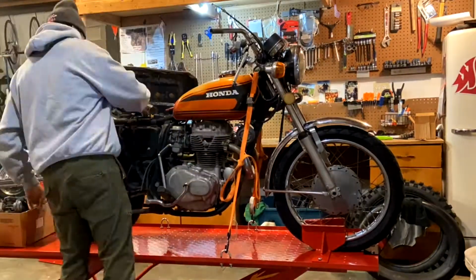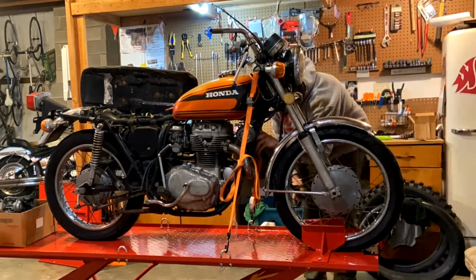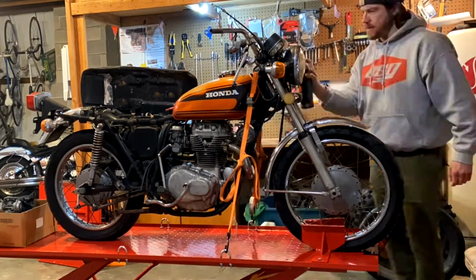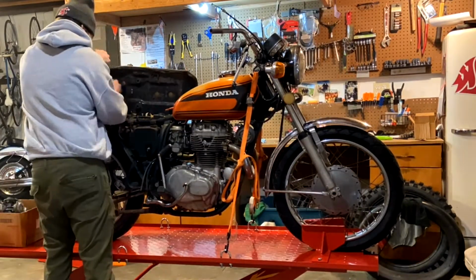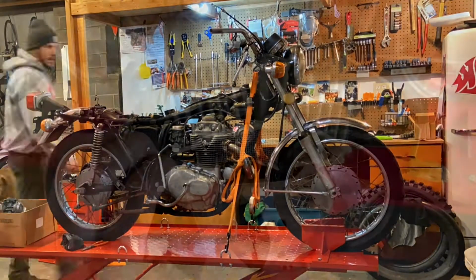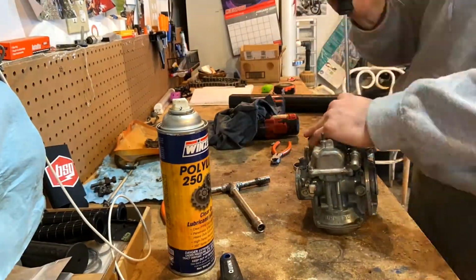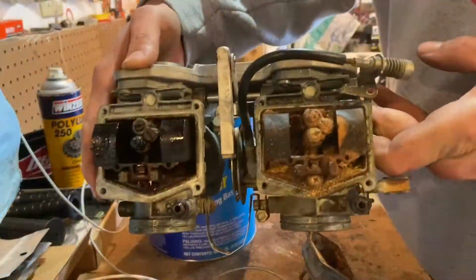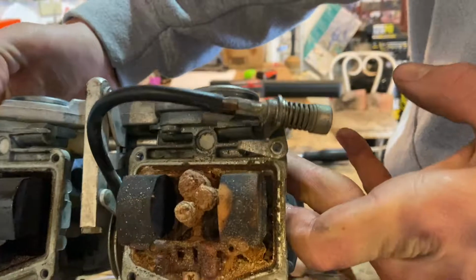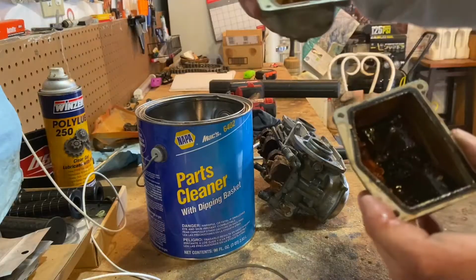Big front suspension, extended swing arm, and I got some shocks that I'm planning on rigging up. My brother, who also does some pretty sweet bike projects, is a weld fabricator and has said he's going to help me with some of the metal work. We're going to cut the head tube somewhere round about here on the seam and then fit the other moto head tube on there to reuse that triple clamp and steering stem setup to use the bigger forks.